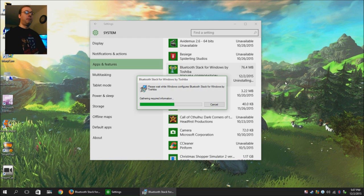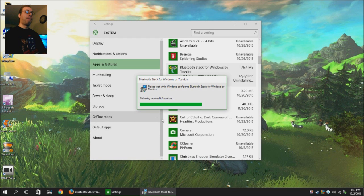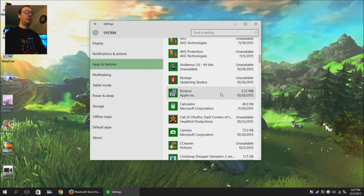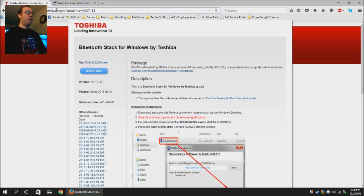This will make sure that all Bluetooth software is removed from the computer. Because if you just try to install the new stack with other stuff installed, you get a conflict — it just might not work at all, stuff can get confused. So it's better to get rid of the old stuff before you put the new stuff on. Probably save you time and some trouble in the long run. Once you get those done, go ahead and go to this website — there will be a link in the description. I've also updated the link in the other Wii U controller video descriptions. They don't have the Bluetooth stack listed with all the regular drivers anymore, so this is a link to the most current version available.